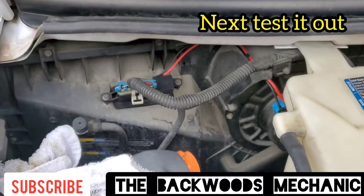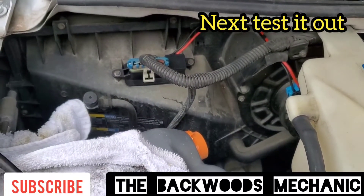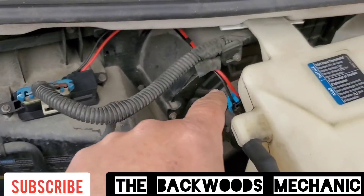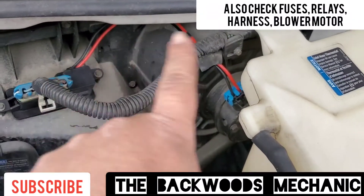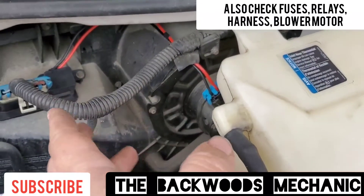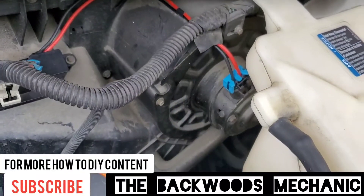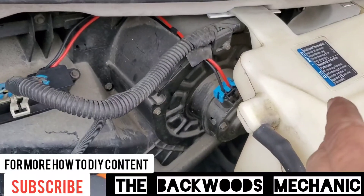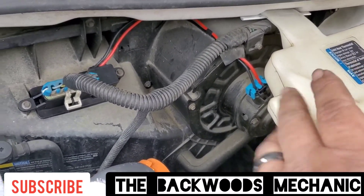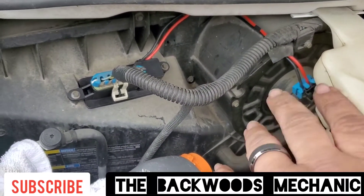Then you go inside your vehicle, turn it on, turn your fan on high, low, medium — verify that all of it works and you should be good to go. Now, if that doesn't fix your problem, you're going to want to look into your wiring harness itself that goes through right here, because you'll have to change it. You can buy them, cut the wires, stick it right back in, wire it back up and it should be fine. Or you'll want to come over here and check your blower motor itself. Of course, fuses and relays — that should always be the very first thing you check. But most of the time, this is the problem you're going to run into when one or two speeds work and the others do not.